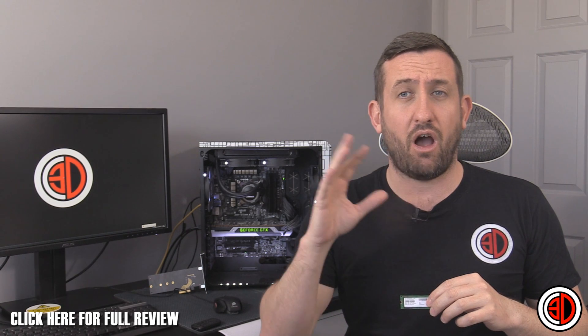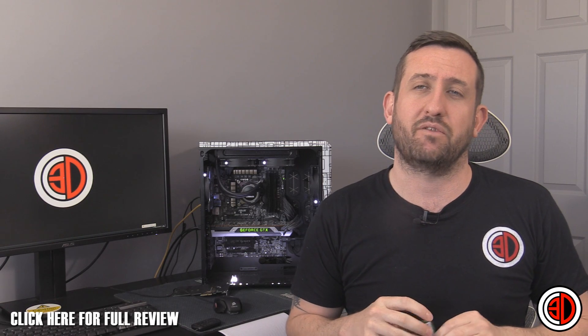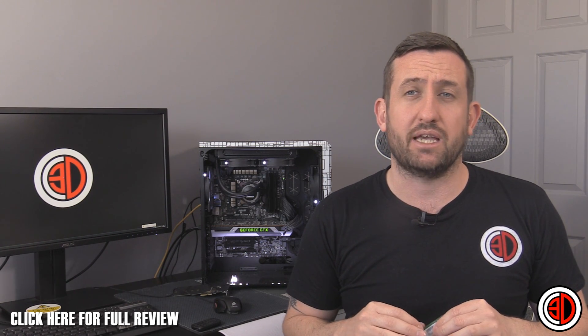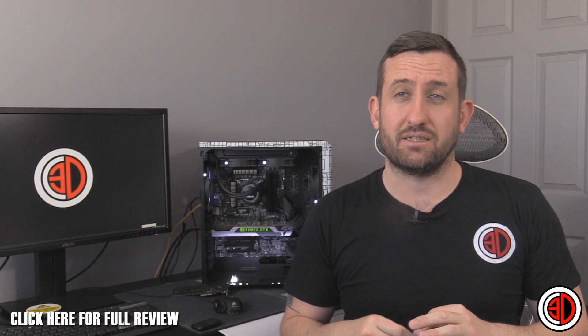The problem with this PCI Express variant is it's actually pretty damn fast, so you need one of the higher-end motherboards — an X99 motherboard or a PCI Express add-in card to get the full speed from it. On a Z97 board, M.2 runs on PCI Express 2 bandwidth, because the M.2 shares that bandwidth so it doesn't interfere with the limited PCI Express 3 lanes. There are only 16 lanes, so if you've got a graphics card it's using them, and two cards share eight lanes each.